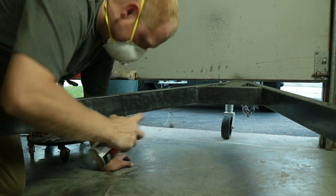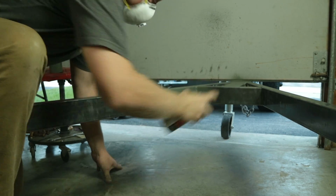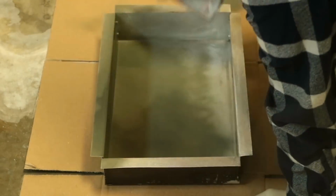So now there's actually a couple different ways you can go about painting the actual trailer itself. My method was to actually just use spray paint. Spray paint's cheap, it's effective, and you don't need any tools to actually spray it on. Now I started with a self-etching primer. And this one's made by Rust-Oleum. I'll definitely have these linked down below in the description so you can go check these out. And that self-etching spray paint is actually really good for painting aluminum. I have another video if you want to go check that out.